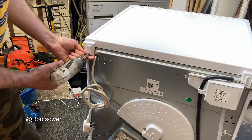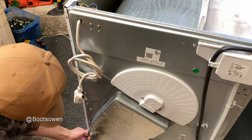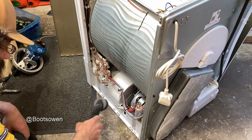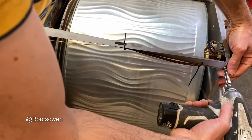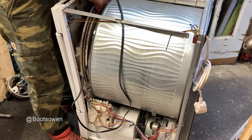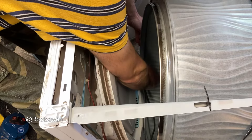On the back there's two screws — I find it tricky, you kind of pull it and lift at the same time. What we're hoping for is to separate the front and the back — that's it, just slides back. I have to loosen it to get the drum apart from the front seal, getting the belt in through this gap here, in between the drum and the tub.